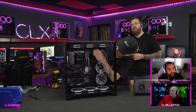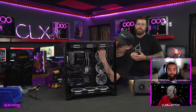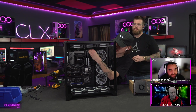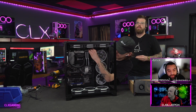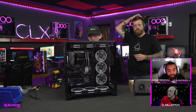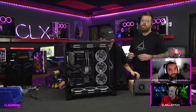So in turn, we had to come up with something that was, one, producible by the guys in assembly, that would still keep the simplicity of how everyone uses a computer now, and be reproducible, right? We have to be able to produce these units for customers. So that's where this configuration comes into play, where we're using the micro ATX inside of an ATX build to gain that extra space for the NUC and for the capture card.